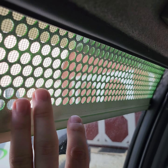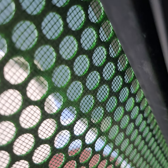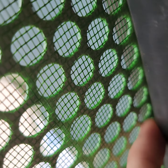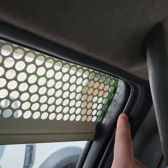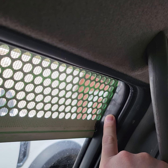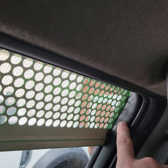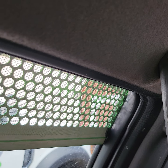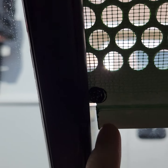As you can kind of see, this is my screen. It's green because I painted the outside but left the inside white — I just don't want it to be a cave inside my van, so I like to leave nice light colors. The green adds a little bit of a hue but it's not too crazy. If you notice up in here, that edge sits inside the track of the door frame where the window sits. Same thing over here — the edge sits inside the track where the window sits in the door frame. I measured from this dimension all the way across to the other, and then I added the depth of that track to my dimension. You might need a little poking stick to figure out what that depth is, then double it and add that to your overall measurement for your piece.